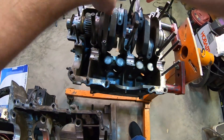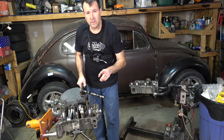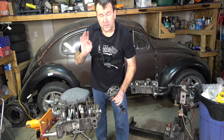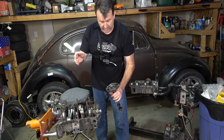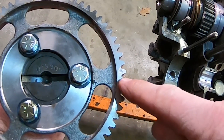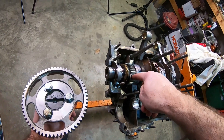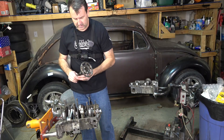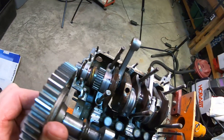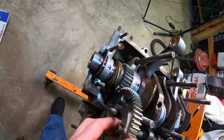Now the fun stuff. We've got the crank installed in one of the case halves. I want to show you how to drop this camshaft in quickly. Earlier I showed you how to mark the main bearings for easy installation - I'm going to show you what I like to do. I used a paint pen - you rattle it and dab it to get the paint out - and it's still on there after 20 years through a lot of oil. I marked a single dot on the crank gear and two dots on the cam gear with white paint. The dots on the factory gears can be really hard to see, so this just makes it easier. I like to kind of stick the gear on to make sure it's all lined up, then roll it down into spot.